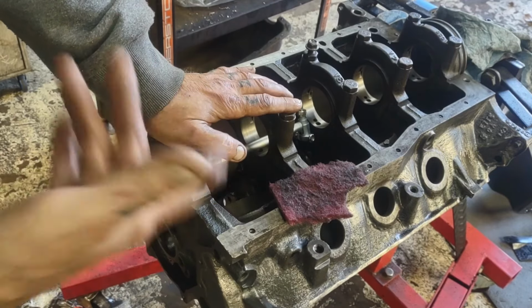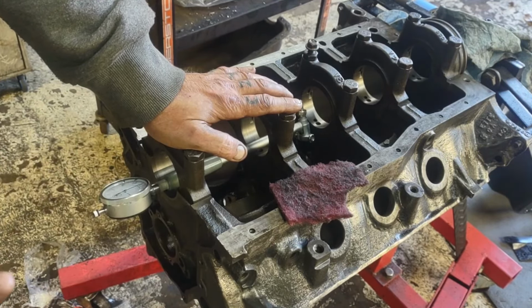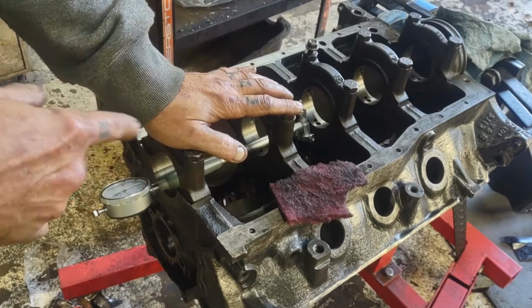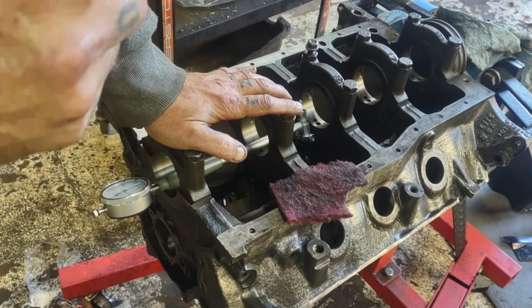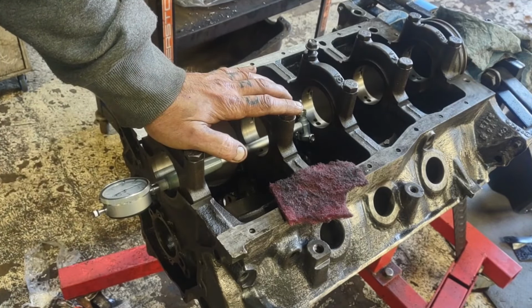But that's basically it. And from the checks I've done so far, my rods are within spec. My mains are within spec. So I don't have any problems with metal being shifted or anything like that. And I can go ahead and finish this thing off. The next thing this needs is a final hone to the size of the pistons that I have, but that'll be for the next video.